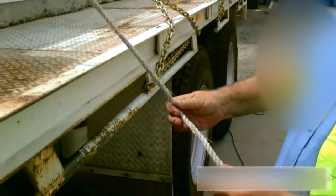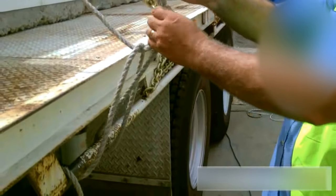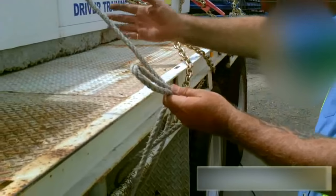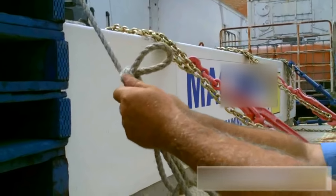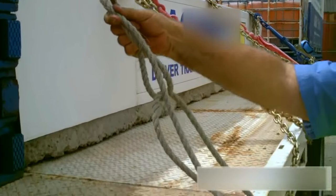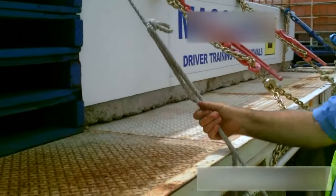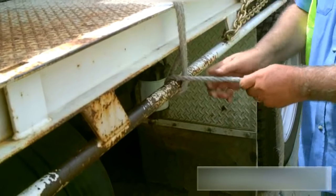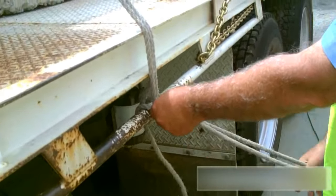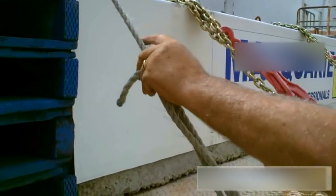You'll find that in the transport industry what most drivers will do is come through the rail. Pick the rope up through the inside of that loop and again we're back into that position with a loop in the left hand. Right hand up on the rail, left hand goes up and we make the truckie's hitch. Pull down tight, pull the rope tight and pinch. Now this time we have the rope on the left hand side. In order to lock that, you can pull it through, pinch it tight and straight back to the basic clove hitch where it locks across the rope. Bring the rope in and secure the loose rope above the knot.